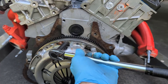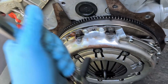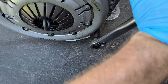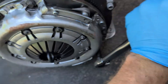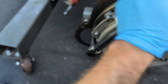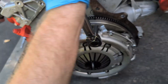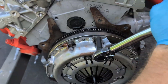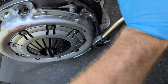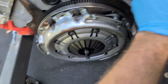I'm going to go to 10 foot-pounds first just to make sure they're all seated properly. Do a few turns on one bolt, then zigzag over to another and do a few more turns — as you can see, it's still pulling the pressure plate onto the flywheel evenly. Just take your time and pull it in evenly. When you go back to the original spot, go to the other bolt, not the one you already turned in. Keep doing that until the bolts get to 10 foot-pounds, then go to 26.